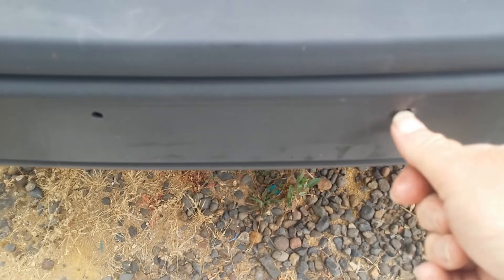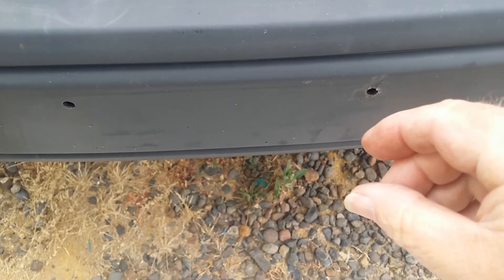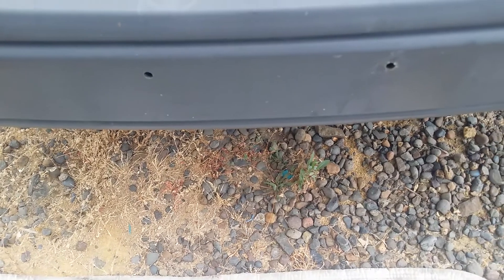I've stuck a little screwdriver in through this hole and I have around three-eighths of an inch of depth. I've already compared it to a quarter-20 nutsert — also called a rivet nut — to know that there is just enough room for it.